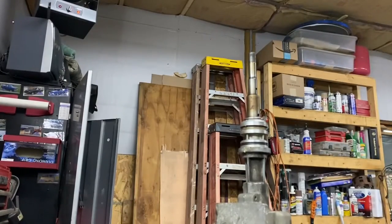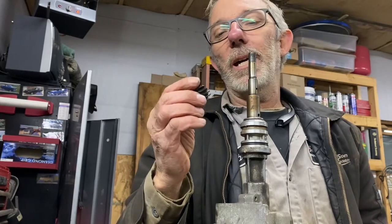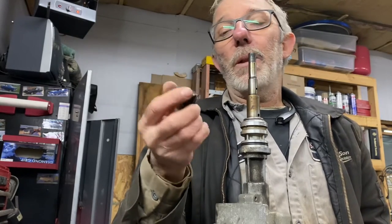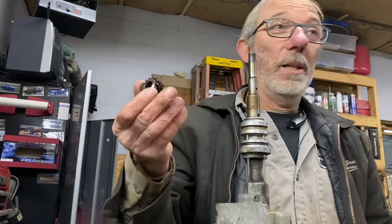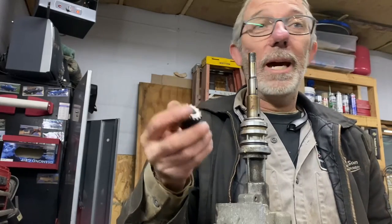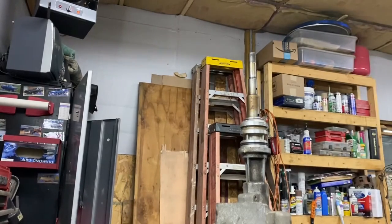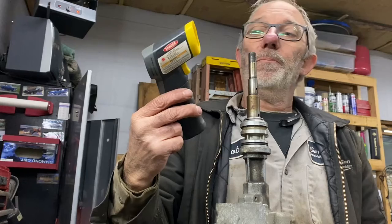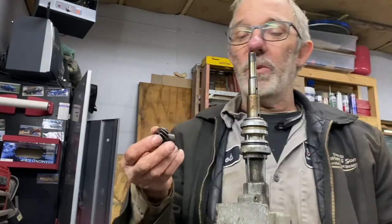The other hard part was that you can get these up to — a lot of machinists say five or six hundred degrees is going to hurt it, which I agree with. I thought about possibly using my barbecue grill because they get up to about 500 degrees, just let it get as hot as it can in there. Or just a propane torch and one of these temperature guns, which I might do because I'm kind of impatient. When we did my son's we just instinctively heated it up and it was fine, but the problem was we were a little bit off on the alignment hole.